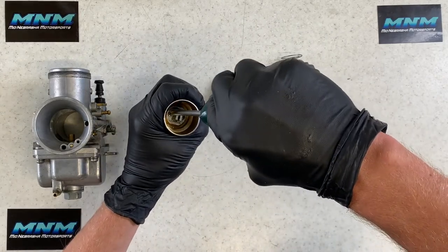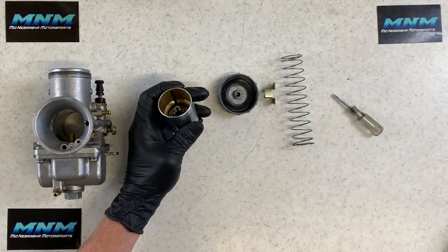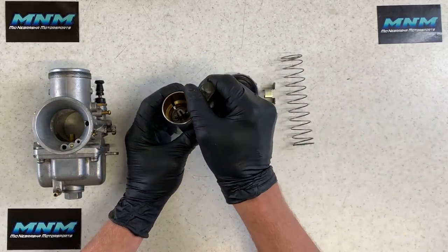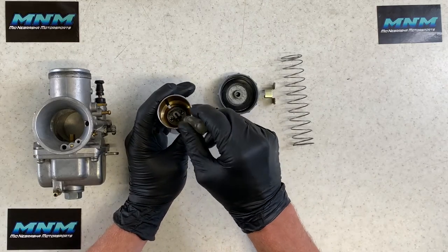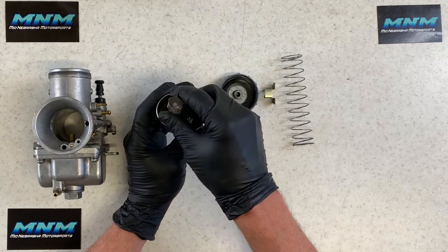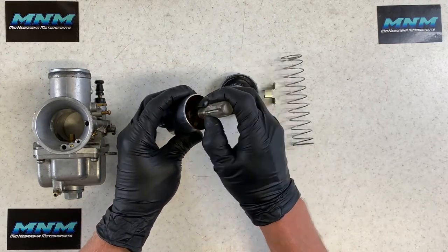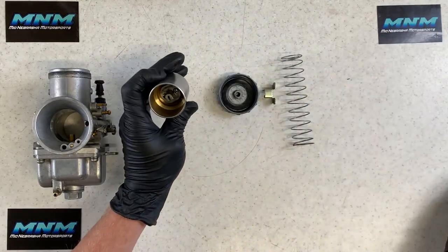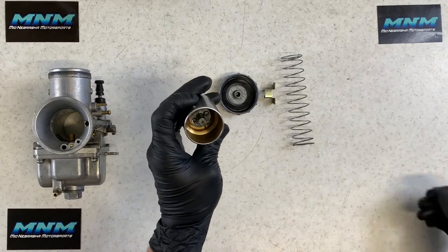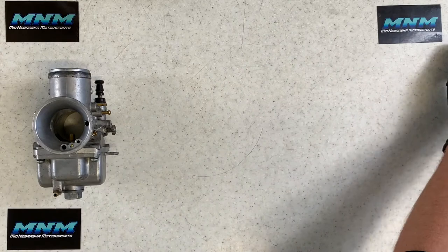They also make different sizes of needles — those sizes are engraved right on the needle, so make sure you check that and get the right one for your motorcycle and riding conditions. Going back together, slide that needle in, then slide the holder down — it doesn't matter which direction that goes — and tighten up the Phillips screws. Your throttle cable slides up through the groove, hooks into position, and to remove it just push it down and slide it out.